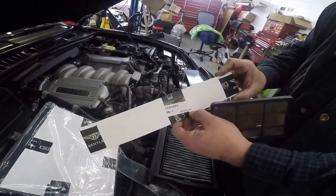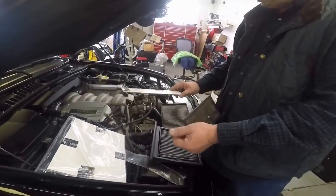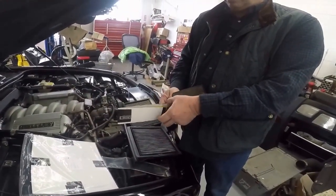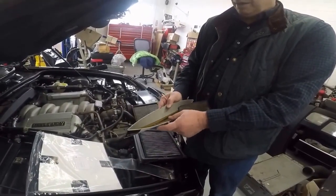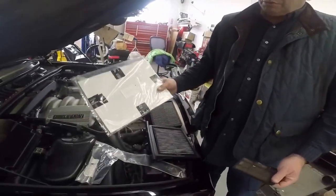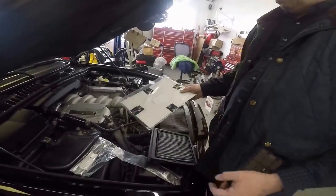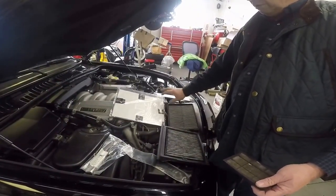The rubber's already expired — dated 2012 — in this 2005 car, so we're not going to use this seal. You will need two of these. There's actually two in the larger seal part number, so you're okay — you can order that part number and you'll get both larger seals. So: smaller seal PA26393PA, larger seals — order the pollen filter body gasket part and you get two.